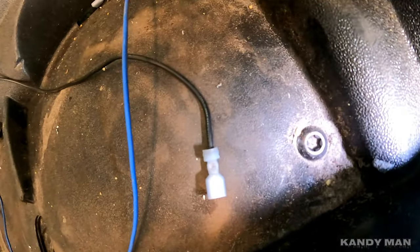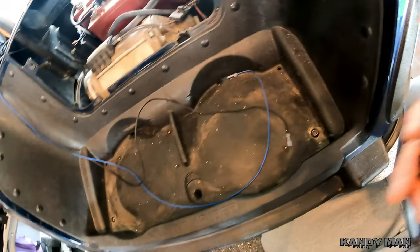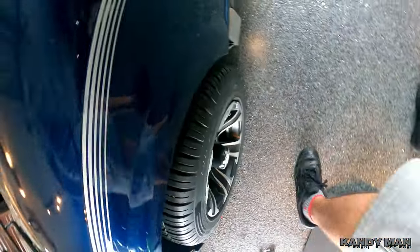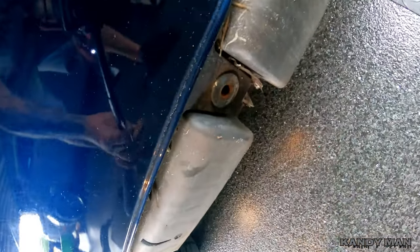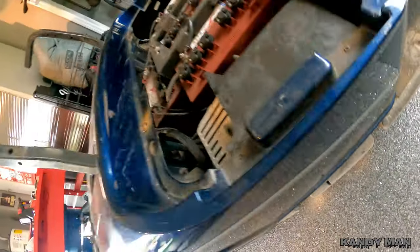All right, so you can see it's mainly a lot of Torx heads that hold the body on, and it's definitely worth having a cordless ratchet. So I've been buzzing out a lot of these Torx heads all around the body of this thing. They got their little guard plates you take off, and then you can get to your bolts for the actual body itself that'll slide up off of here once we're ready.